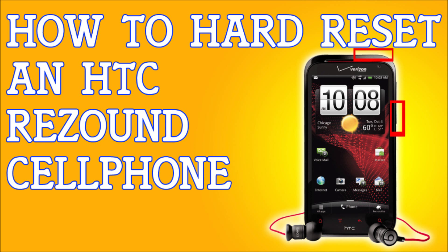When you see the three Android images come out, let go of the volume button. You'll be presented with a screen where, using the volume down button, you go down and select factory reset. Once you select factory reset, press the power button to confirm.